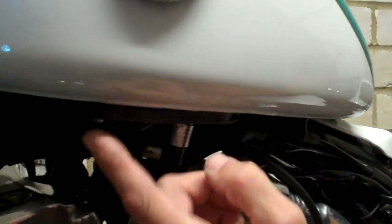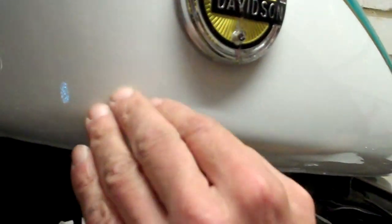Right, as I said just now, the fuel tank on a fuel injected bike is a part of the fuel injection system, and you have a plate on the left hand side of the tank. There's nothing on the right, so you have this plate on the left hand side. Now this plate holds, come on down and look up underneath more. On top of this plate, there are 2 cylinders that go up about that far. One is the pump that pumps the fuel, and the other is the filter. And obviously there's a sender unit in there as well that gauges the level.